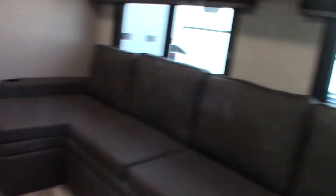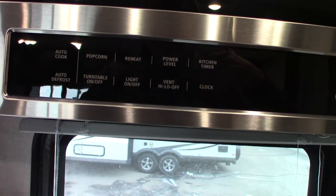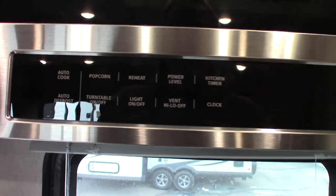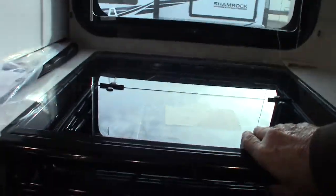These can be configured to sleep areas as well. There are tables that fit into these mounts here. The microwave works like any other microwave. Remember the vent here vents to the outside — you have to open that baffle, otherwise the venting will just bounce off the baffle and back into the trailer. So you always want to have it open. It's got a two-speed fan and a light.